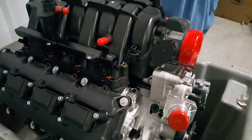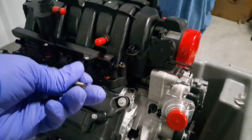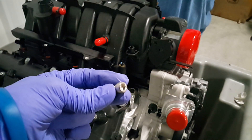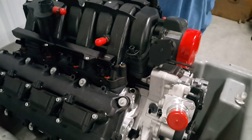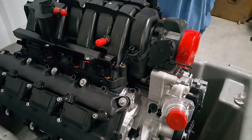Installing the fuel rail is pretty straightforward. You want the logo facing forward — this fuel rail is the passenger side. The stock fuel rails came with a longer screw or bolt, and we just took that out. 4 Innovations supplies you with some nice bolts — I think these are stainless, maybe just zinc plated — they'll recess into the fuel rail itself. You don't use the injector clips that come with the stock setup; the fuel rail just sandwiches the fuel injectors into the intake. We'll install everything else — the fuel regulator, the pressure gauge, and the other fuel rail — and then we'll show you guys how it turns out.